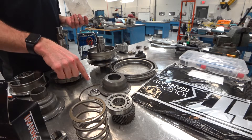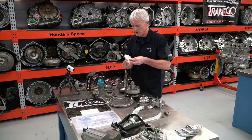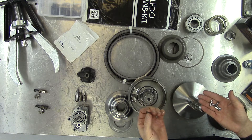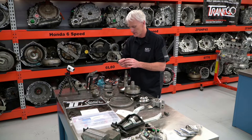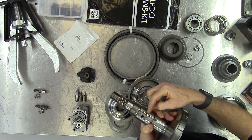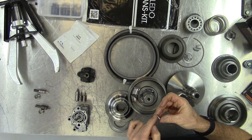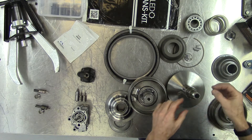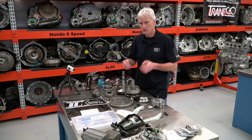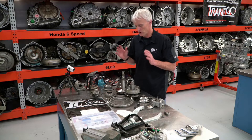Now with some builders, instead of going back with ball-bearings, with their seal kit — this is from Seal Aftermarket Products — they'll actually put in rollers in their place. Newer CVT units, like Hondas, actually use rollers from the factory, so there's really nothing wrong with this. Instead of having three ball-bearings, you have a roller that is the same length as three ball-bearings put together. So now instead of just point contact on each side of a ball-bearing, you have the full contact of that roller pin in place — that is an upgrade. Some techs don't like to put those in; they feel they're too tight. If they are too tight, there's nothing wrong with going back with ball-bearings — just make sure they are new ball-bearings.